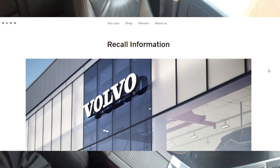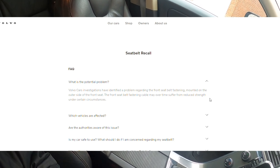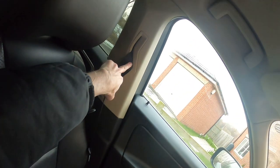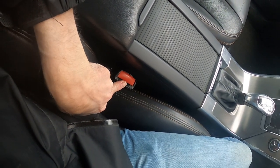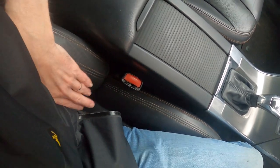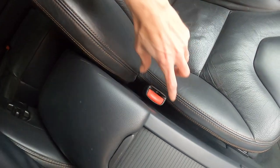The other thing that they did — and it's difficult to get you a shot here — is that they did a recall. On Volvo cars there was a recall for the front seatbelt pre-tensioners. The pre-tensioner lives in this bit — there are actually several pre-tensioners. There's one in the main component of the seatbelt in the pillar, which is the key one, but there is a second pre-tensioner which is an explosive charge that goes off and pulls this part of the belt down, helping to force you into your seat. This is where the recall took place — the seatbelt anchors had rusted the metal cable, and it could corrode and cause damage.